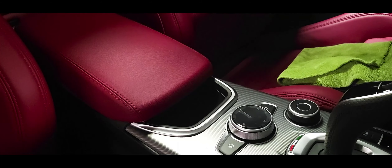Before anyone goes and just picks up a bottle of ceramic coating and uses it on your interior, let me tell you the difference. There are two types of ceramic coating: one that you use on your vehicle's paint and the other that you use on your interior. Your exterior ceramic coating bonds to your paint and forms a hard shell barrier that protects against natural elements such as bird poop, acid rain, water spotting, etc. Your interior ceramic coating is specifically made for leather, vinyl, and plastics, and that ceramic coating is more flexible. The product we're using today is not going to change the look of the leather, it's not going to change how it feels, it's not going to stiffen it up — again, because it is flexible.